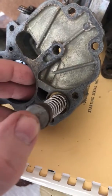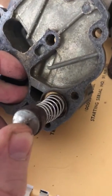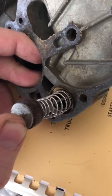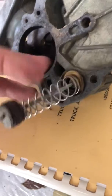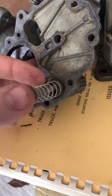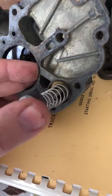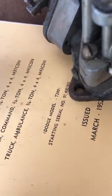The pump gets sucked up by the manifold vacuum and is under spring pressure. When you step on the gas, your manifold vacuum drops and it pushes your plunger down. So if you're starting your truck and treading on the gas pedal thinking you're going to be working the accelerator pump — the throttle doesn't do anything on this until the engine is actually running.